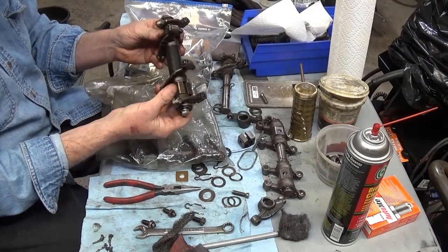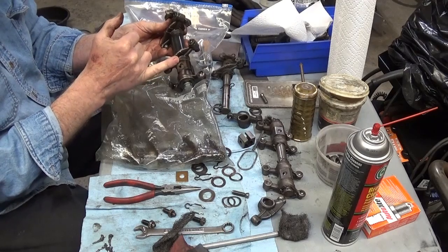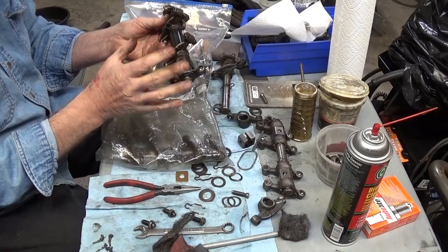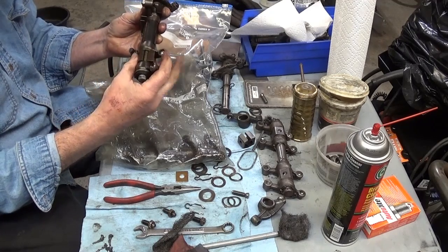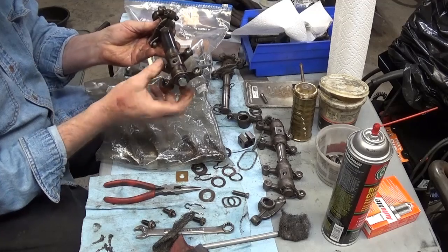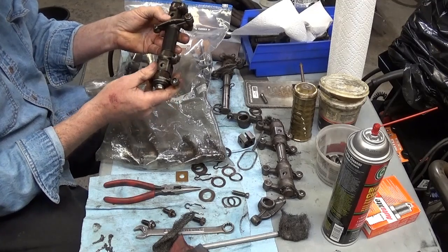But when you go with these solid shafts, you want to make sure that you have at least 5 thousandths clearance minimum. You don't want it tight because things expand when they get hot, and you don't want it where it galls the bearing surface and screws things up. And you can see where I actually put a spacer on the side of the block. Must have been where it had to be on this one, because it's not on the other side.